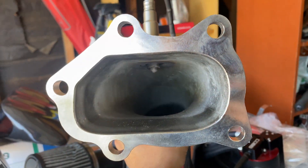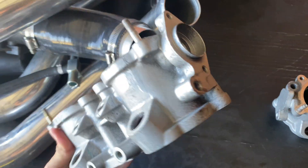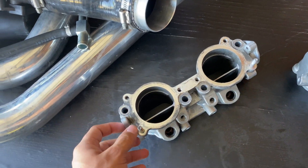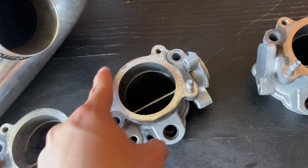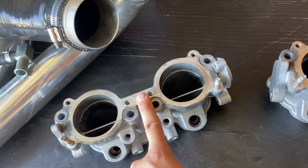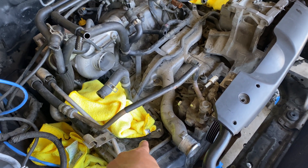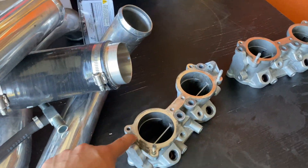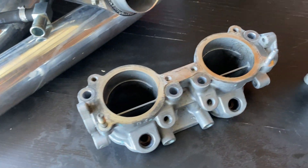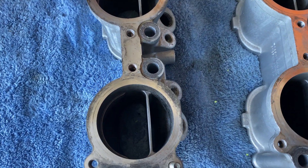Very excited to have that. You can see the sensor right there. Now let me clear the table. We have our TGV-deleted TGVs here. First thing I'm gonna do is clean the surfaces on these TGVs and get them looking shiny and nice, because when you put the gaskets on you don't want dirty surfaces or you'll end up with leaks and have to take it all off again. I'll be using some brake cleaner with a towel.